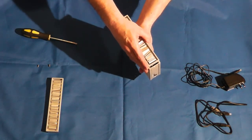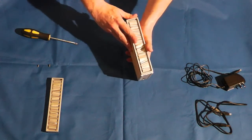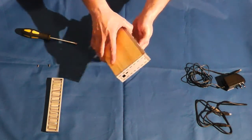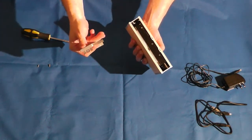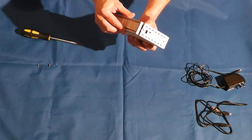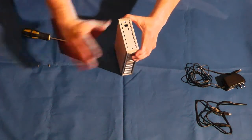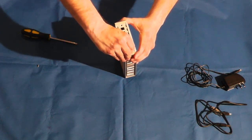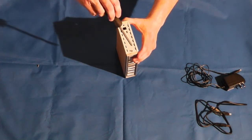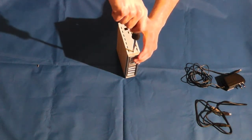Now on here there's a screw hole on one side, and kind of a peg on the other. So what you do is move this in, slide that in, and then this slides up and locks into place. And then you can go ahead and do the other side. Again, you want to make sure the screw hole goes onto the circuit board side. Put that in, and then put in the longer 2 screws that it comes with and screw those into place.